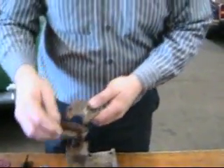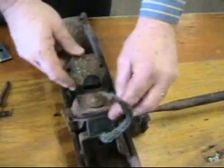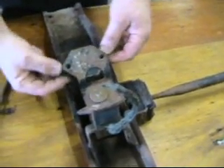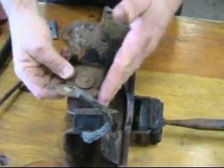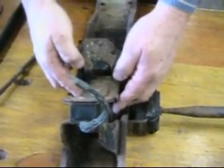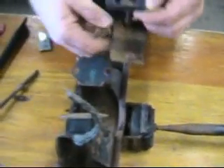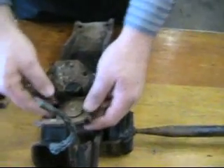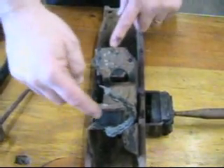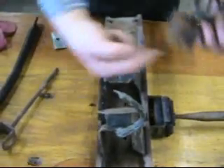Now let's take a look at this piece. It fits in like this, so that the kickback here is towards the rear. If it is an overdrive, you've got some room in here to maneuver to get the bolts in. The flat side goes in front, and the bottom then sits as it would naturally hang. You can see that the bolts are offset to the front. For a standard gearbox, this is the proper assembly. When you go to put this together, I always put the mounts on snugly first, then put the bolts through the bottom that attach in here.